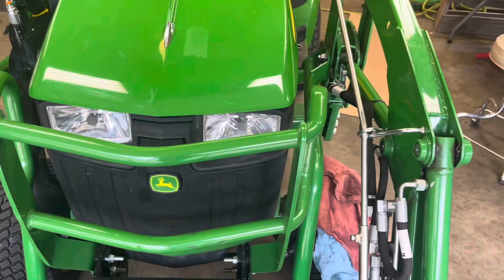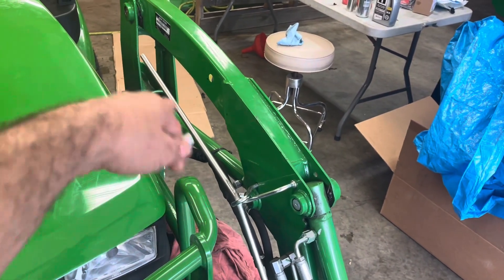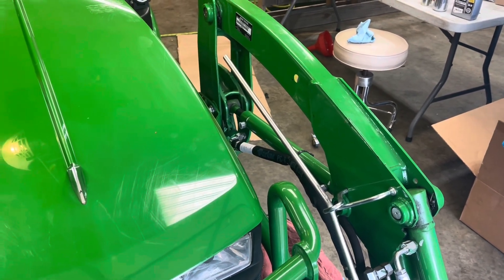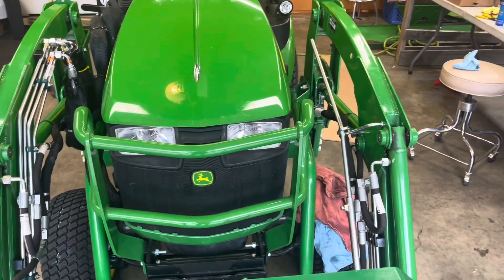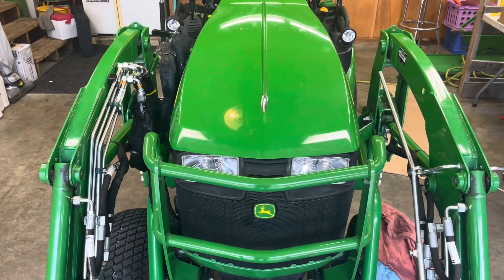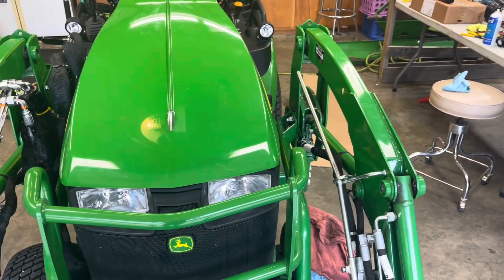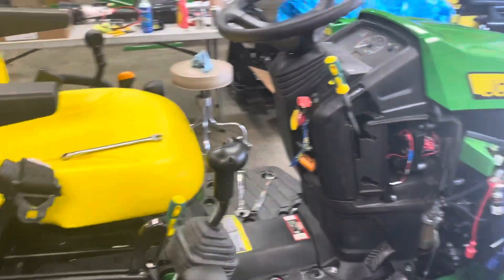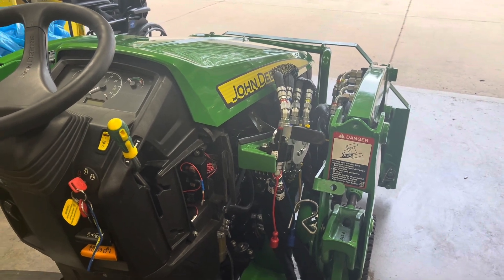Seal kit looks to be about $85 at John Deere plus tax. Just wanted to let you guys know that the test fittings are really simple — just two nuts that mimic the cylinders. I'm not a hydraulic genius by any means, but I appreciated all the input and just broke it down to troubleshooting these cylinders. I had a feeling it was like that, and John Deere did tell me that if you have a load in your bucket and you hit a little dip without ballast and it jolts, those usually take it out. But anyway, that's how you solve it — two test nuts in your toolbox, and you can check those pretty quick by disconnecting and running it up and down. Thanks everybody for the help. I just thought I'd post this in case somebody else runs into that same issue and is scratching their head. That'll solve the problem. Thanks.